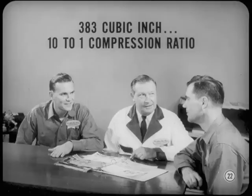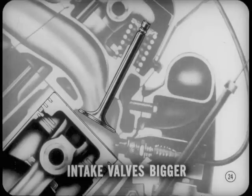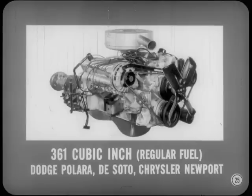Now, here's bigger engine news. We have a 361 cubic inch engine with a Bendix Stromberg WW two-barrel carburetor. This baby has a compression ratio of 9-to-1 and will deliver outstanding performance on regular fuel. 9-to-1 and on regular fuel? That's really all right. Oh, it's a prize power package, Ike. Intake valves are bigger for better engine breathing. And this has been made possible by changes in the cylinder heads. Piston height has been decreased 25 thousandths. What models get that regular fuel 361 cubic inch engine? It's standard on three models, Joe. The Dodge Polara, DeSoto, and on the Chrysler Newport.